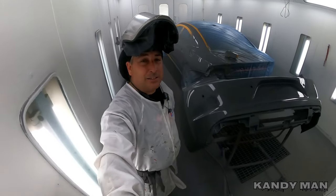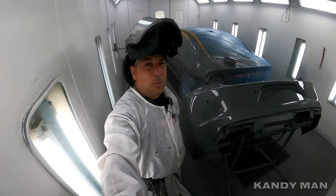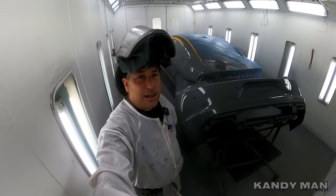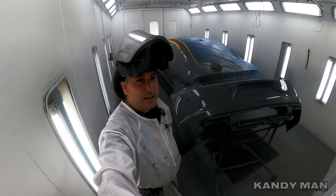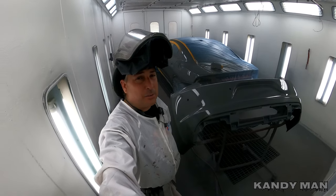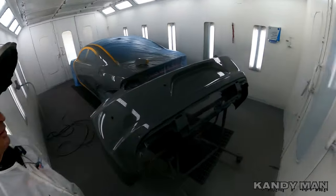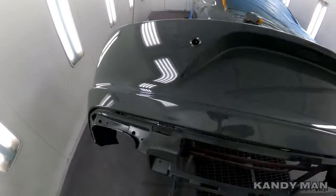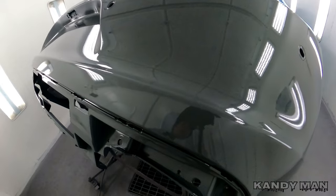See, it looks like it's laying down a nice coat of clear, and it sprays a little bit more fluid than that Bellaria I have. So that Bellaria doesn't have that tulip head on it. This one's got that tulip cap, so I don't know if it's making a difference for that, but it's putting out a nice amount of clear with a beautiful big fan and a flat coat. And that's one coat of clear with the CC200. And it already looks slick, so we'll put one more on and we'll look at it all together, finished up.